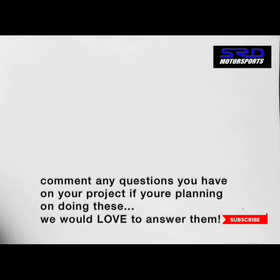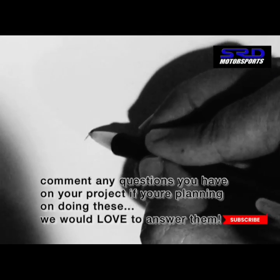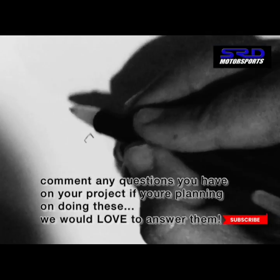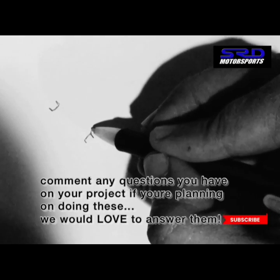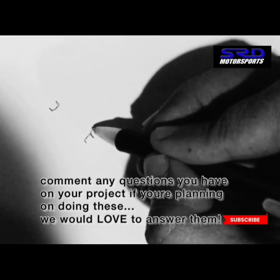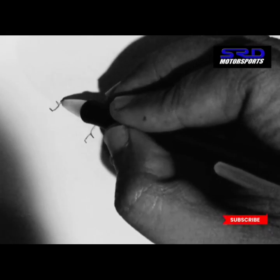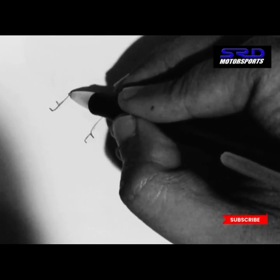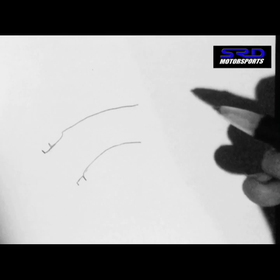We're going to draw the cross-section of an intake port to identify all the things we want to share. We're doing the seat right now — it has to be on both sides of course — and then the short turn with a little bit of core shift, so you would know what to look for on certain heads that need more cleanup than others. That's the short turn; now we'll do the long turn, or the opposite side, with a bit of core shift, and that's the cross-section of an intake port.